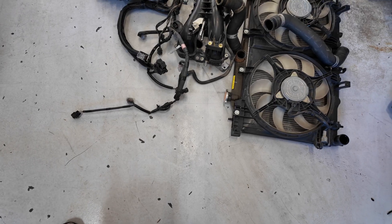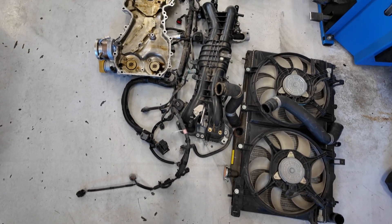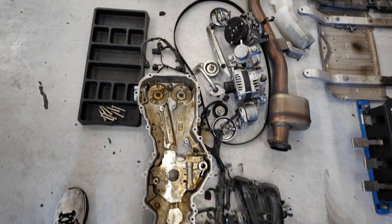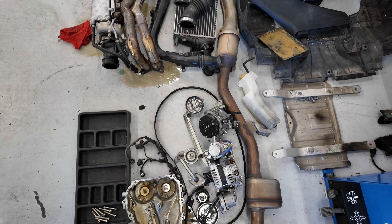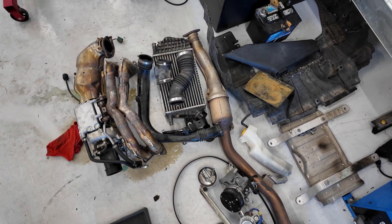We're going to get into some of the details in this car. It's going to involve disconnecting the battery, draining all the fluids out of it. We're going to need to disconnect all the components that are connected to the engine — wiring harness, fuel lines, you name it. Everything's coming out of here. We're going to remove the engine completely, put it up on an engine stand where we can remove all the timing chains. The cylinder heads have to come off. It's a pretty involved job and we're going to give you a couple little sneak peeks as we go through.